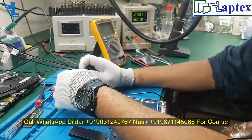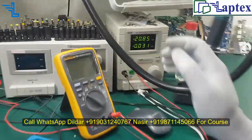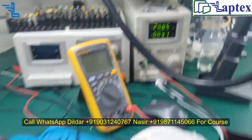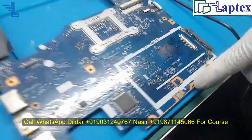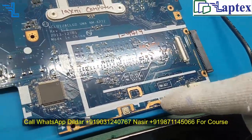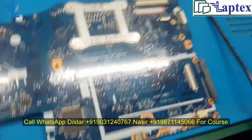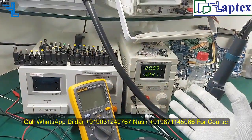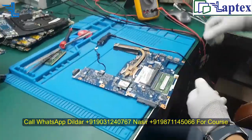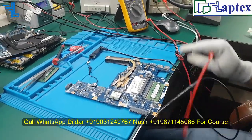Now let me inject the DC jack into the motherboard. You can see the ampere consumption — it seems the laptop is on, however there is no indication. If it is on, you will get a white light on this point, which is the indicator of turning on the laptop. But the ampere reading is telling us a different thing: it is telling us that voltage is available and standby voltage is ready.